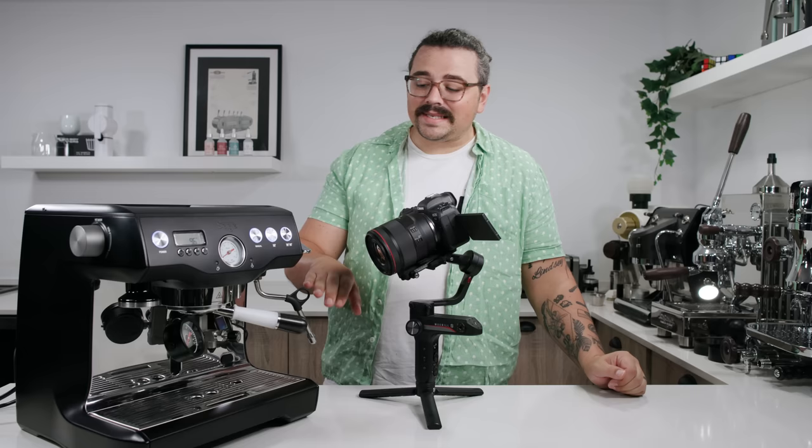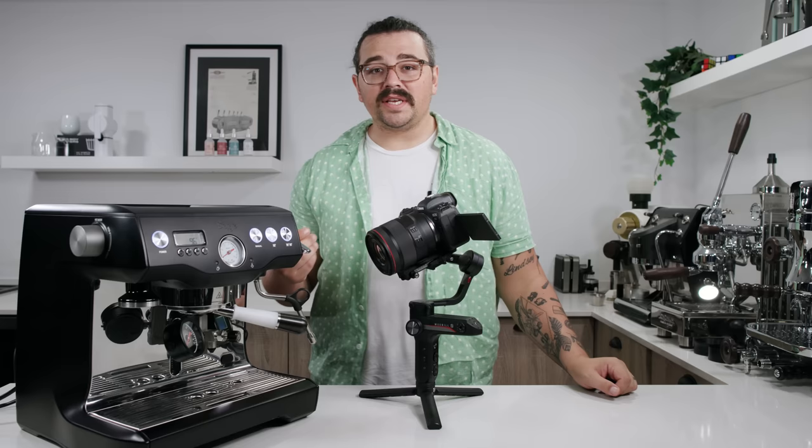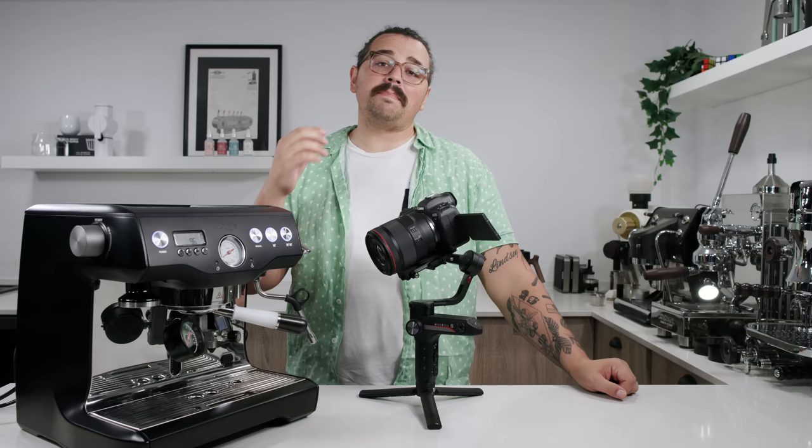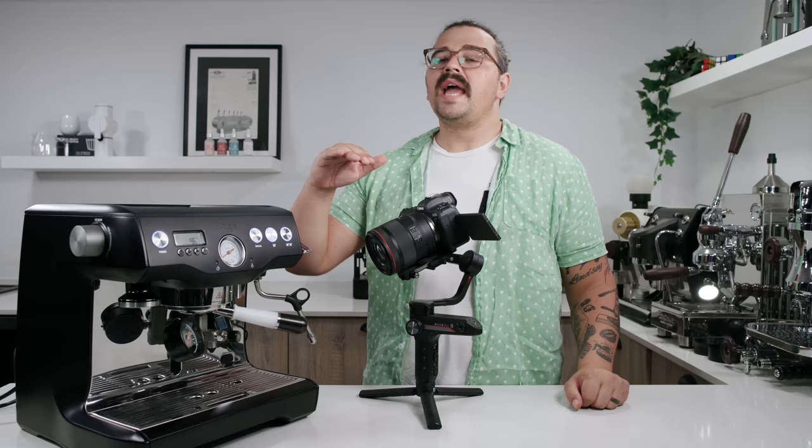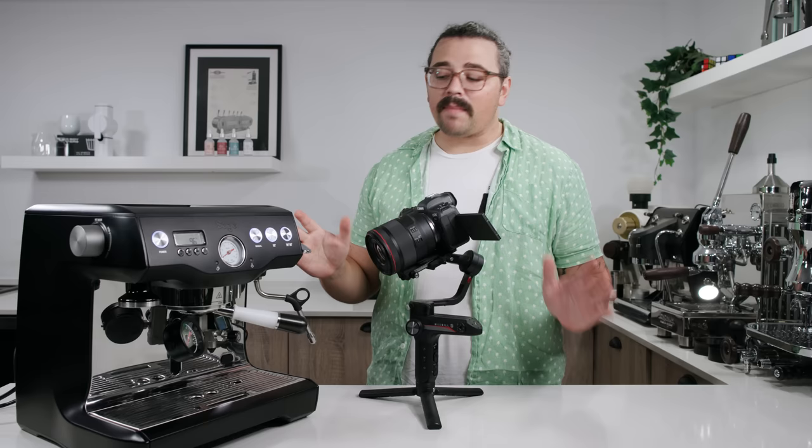What I have in here is the Passato tool that measures both temperature as well as pressure in real time. Essentially there's a thermoprobe inside of the portafilter. Now, one of the downsides of this is, unlike the SCASE, there's nothing inside the basket to replicate a puck. So there's a lot of empty space, a big cavity inside that water needs to fill. Now, I have warm water sitting in it to emulate a puck, because that puck does take heat away. So this water will take some of the heat away from the machine, and then it'll take a while to stabilize. So keep that in mind as we're watching the real time temperature.